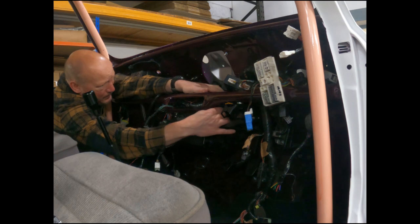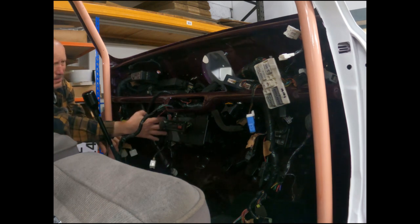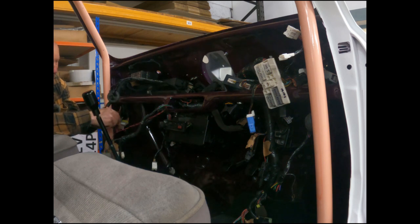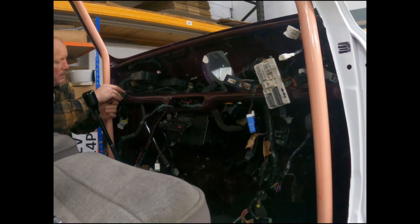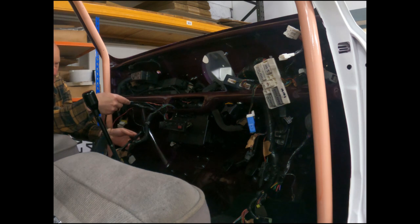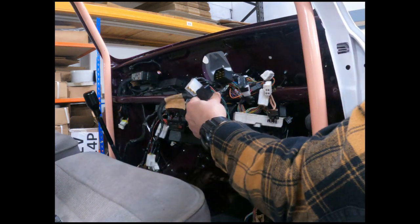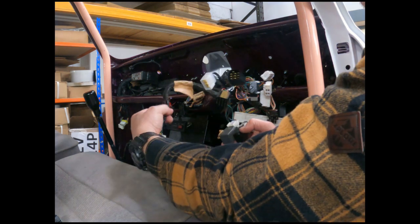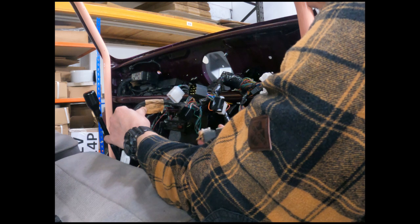So that's up. That's through there. These are where they need to be. We can thread these over there, through there, towards the wiper motor. Switches. Two plugs to engine loom, three plugs to that loom. And we've got the connectors for the back loom and the driver's side engine loom. And that's the driver's door. They must have been just dead ends I cut off.